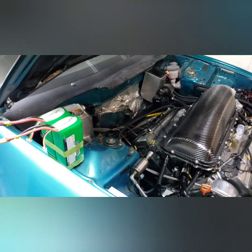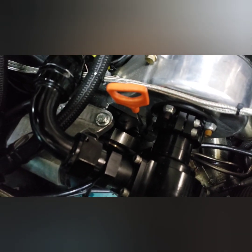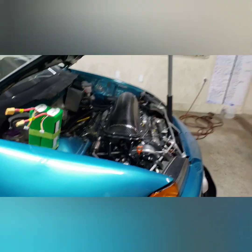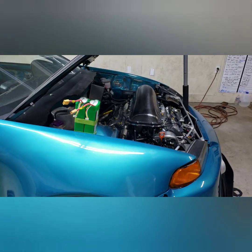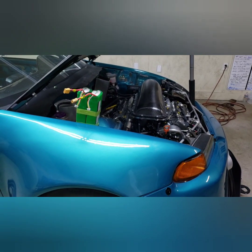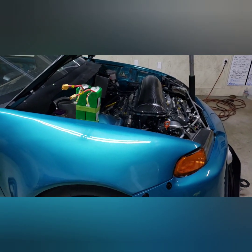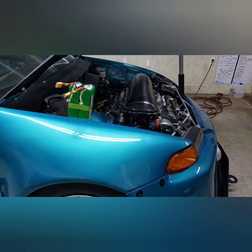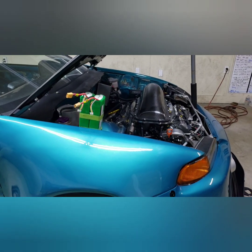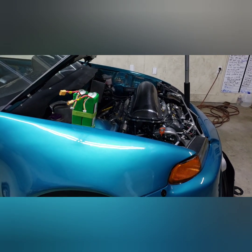Now why do I have 16 volt? A lot of it stems from deep down in there — you can see the balancer pulley, it doesn't have any belt drive on it, so I couldn't run an alternator. Three years ago I was in a huge hurry when we did this, so we switched to 16 volt and I never bothered to figure out the alternator. Fast forward three years to today: I was going to put an alternator back on it but they're all back ordered, so that's not going to happen before this race. I'm going to go back to a standard 12 volt system, 14 volt nominal, because I only own one battery pack and I'm not sure I want to invest in a bunch more.